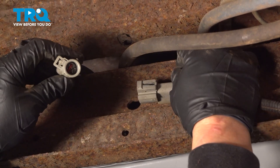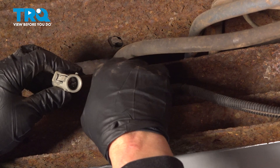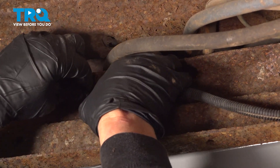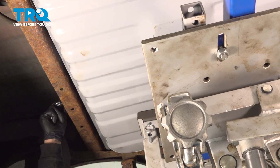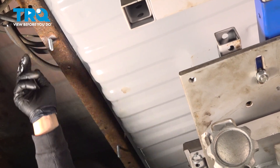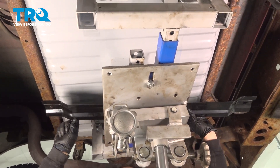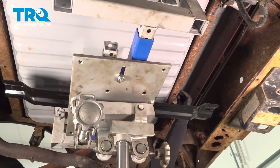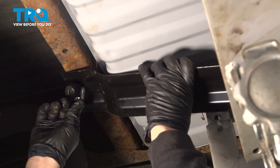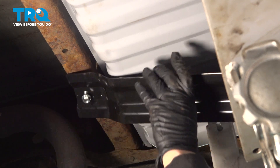I want to make a good note here: this fuel pump actually comes with the harness end, the female connector. So if this is damaged or your wires are shaved, the connector comes with it — you don't have to splice it in, but if you need to, we send it with the pump. Let it click in. Now I'm going to put my bolts through, putting the two longer bolts in the front, dropping them through, and then two shorter ones in the back so I can put the strapping up.